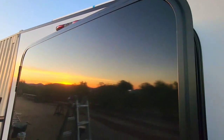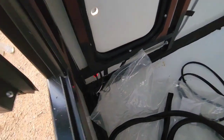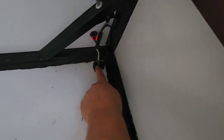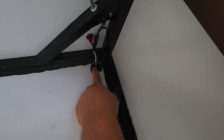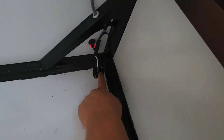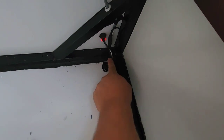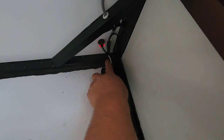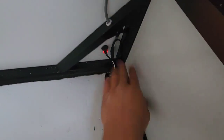Around back I've got the three ID lights. I'll show you this one — basically I drilled a half-inch hole, put a half-inch rubber grommet in, put my wiring through the floor, and then used Sikaflex caulk to seal it. When I put my foam board in, this will fold down, the foam board will go around it, and then I'll make a notch in the flooring for the wiring to stick out. It will all be hidden behind the wall.